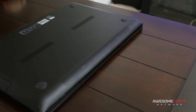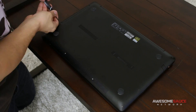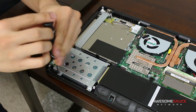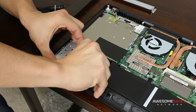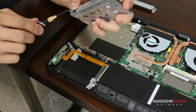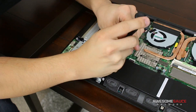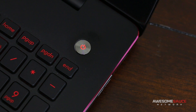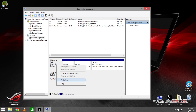After the cloning process is complete, shut down your computer and move on to the fifth and final step: replacing the hard drive with the SSD. Remove the back plate of your laptop with the screwdriver and remove any screws holding your hard drive in place. Carefully unmount the hard drive by sliding it away from its connector — give it a little wiggle if you have to. Proceed to mount your SSD where the hard drive once was by pressing it all the way into the connector. Replace the screws and back plate, making sure everything is tight and secure, then power up your laptop. If all went well, your computer will boot into Windows and run all programs a bajillion times faster.